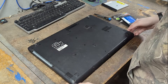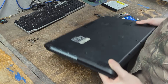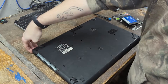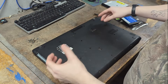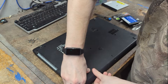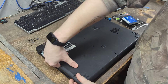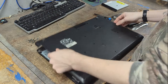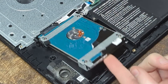All right, it looks like I got all the screws removed. Double-check because you don't want to be pulling on this when a screw isn't fully removed. To remove the bottom panel, just pull up on the corner. A lot of laptops need a spudger, but Acer makes it a little easier on some models — you can just pull up on each corner, run your fingers under it, and do quick pulls to pop the clips.